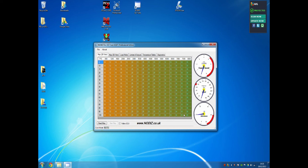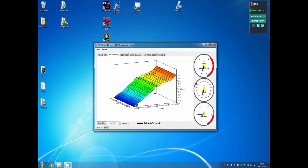Let's look through the software. In front of us we have the 16x16 ignition table. Along the top is RPM, which relates to the columns, and down the left-hand side is load — currently indicated as using TPS or throttle position, going from 0 to 100%. As RPM increases it moves along this way, and as load increases or decreases it moves up and down, giving you a full three-dimensional map.